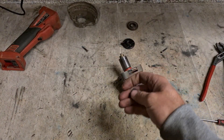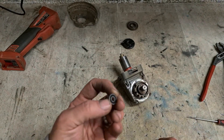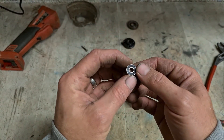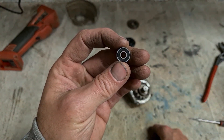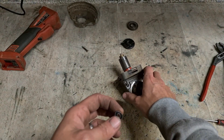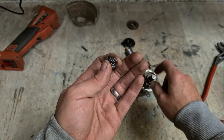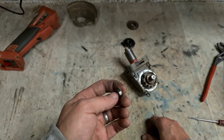The question I get asked all the time: what size of bearing on the Milwaukee grinders? This is a 605 bearing. The ones that are fitted generally have a metal race. Metal is better for higher speed because this is a grinder, but rubber is better for sealing against dust and dirt. Generally these things get badly abused, so it's better to fit a rubber seal. Both will do the same job — metal ones will be better for speed and your batteries, but for longevity the rubber ones will get a bit more time out of.